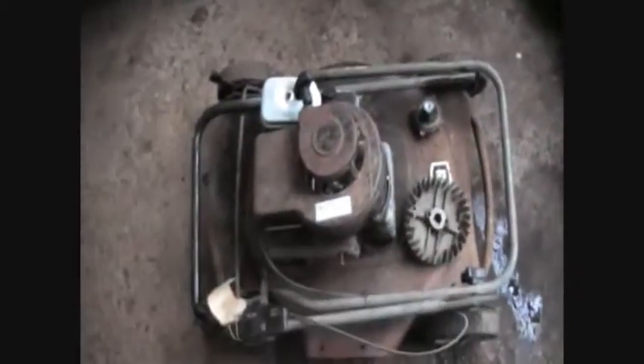If you need anything else, just ask for another video and I'll do that. See you later. Oh yeah, and while I've got the camera out, here's the six-horse Briggs side shaft. It's sort of better, because it's just missing everything. I'm trying to get this flywheel off because I think the key's a wee bit of shit, which would explain why it's kicking back a lot. I need to get this off and it's a total bastard to get off. But that's all clean as well, so hopefully that'll stop it kicking back and get it running a wee bit, because it's been funny.